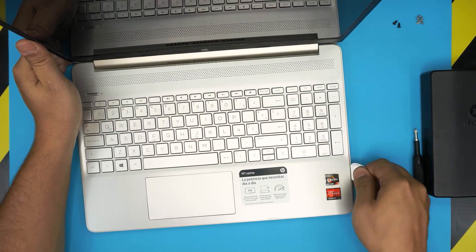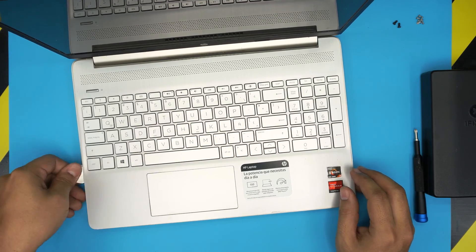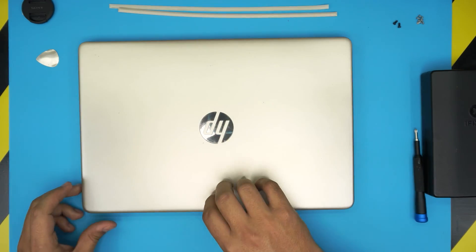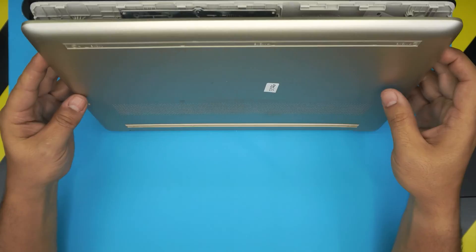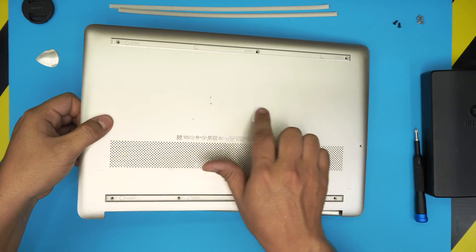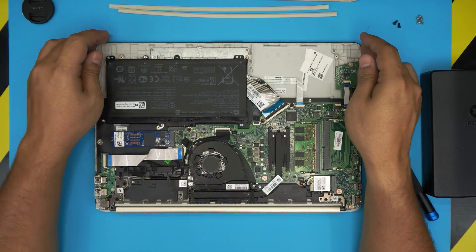Do the same thing on the sides — twist, twist, twist, and twist all along the front and sides. Once you've done the left and right on the front side, close the laptop and open it back up — you should now see the separation between the top and bottom cover. Grab it from the front, put one hand on the hinge side to hold it down, and lift up and pull. There are two clips in the middle — bring it up and push it toward the other side to release those clips.